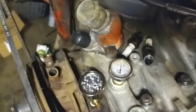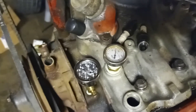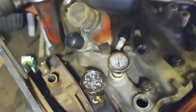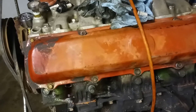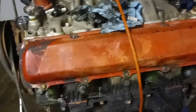If it's a new motor, same idea except just put motor oil down the cylinders, not thin ATF or Marvel Mystery Oil. The only reason I use thin oil with lots of detergent on a sitting motor is because the rings can be carboned up and stuck. All right, until next time.